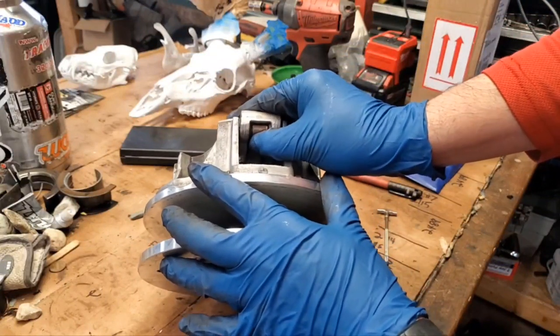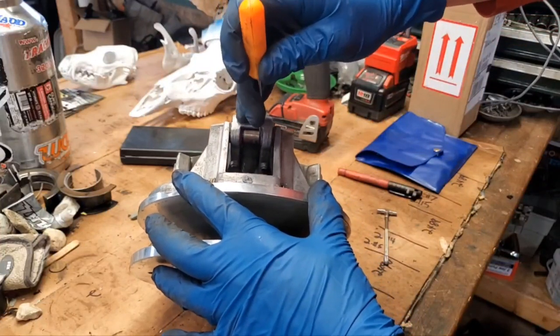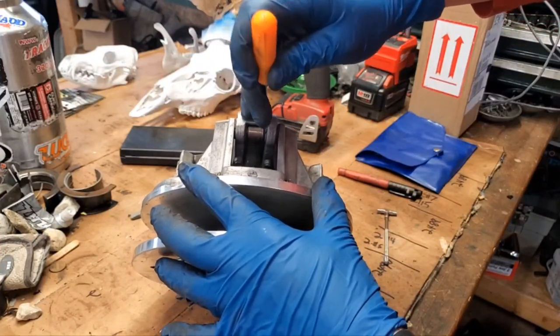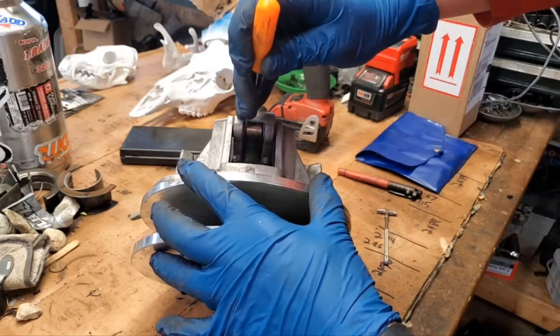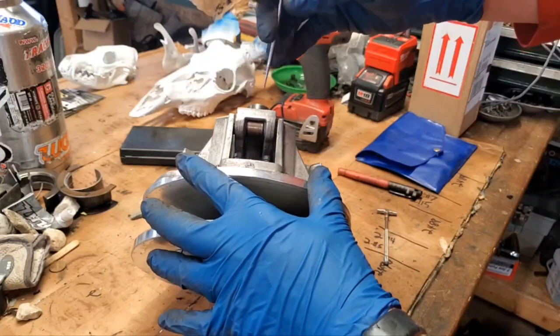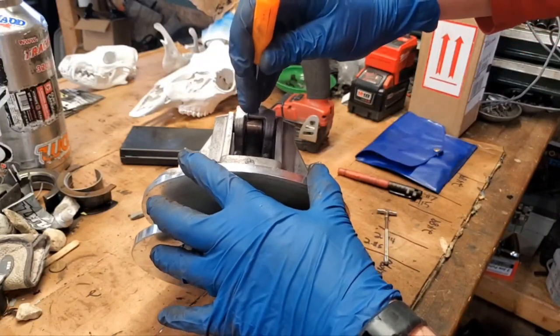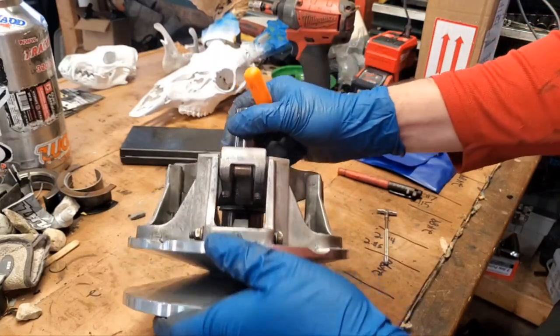Another thing to check, this wheel up here. I'm going to actually grab a little pick to try to show you a little bit easier too. So there are spacers on either side of that little roller there. That's what the clutch or the weight rides on. You don't want excessive movement there. Now there's not a spec for that either, so I can't actually measure it. It's just kind of a judgment call, but I'm not getting very much movement at all here, so that's good.